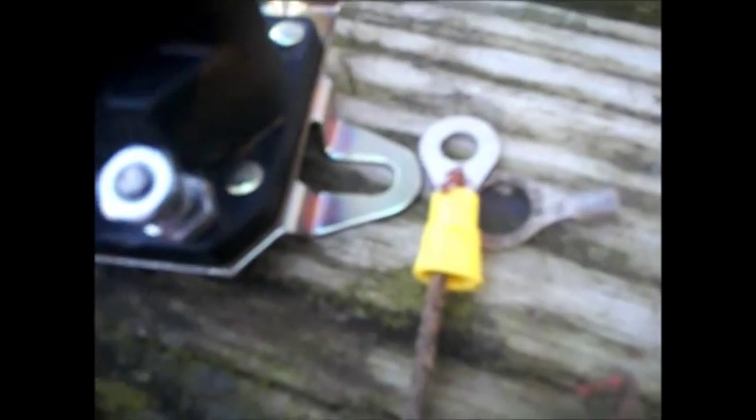I didn't have the power switch grounded. I didn't ground a wire from this post right there. It would plug in just like that, and you could just ground it right to — there's a flywheel with that, but that wouldn't work too good. Because you would also have the ground on the battery grounded there too, and the charging system wouldn't work. So I went to a three-post solenoid.